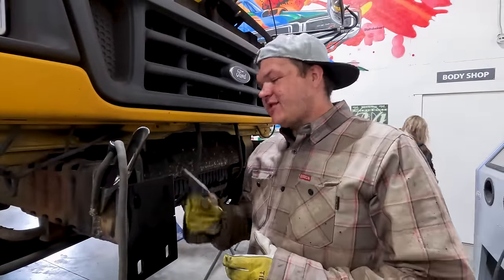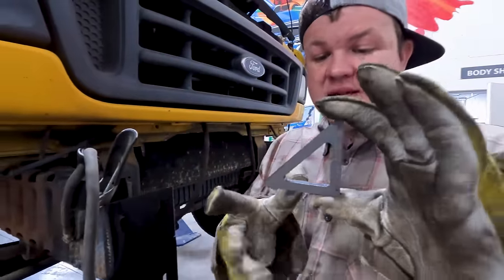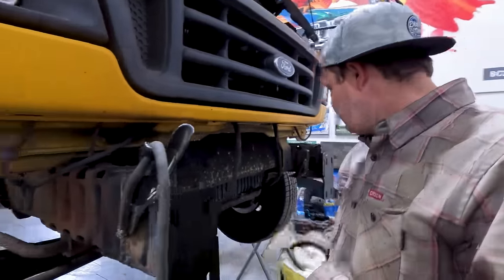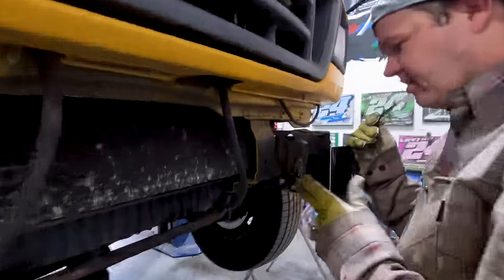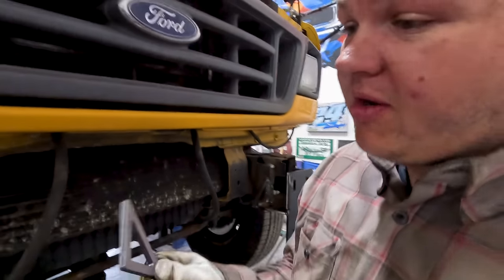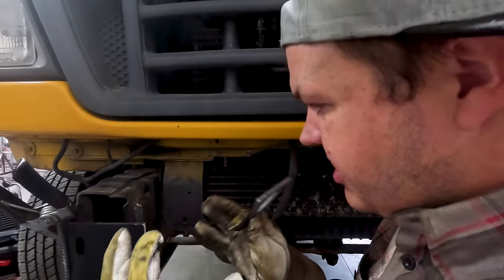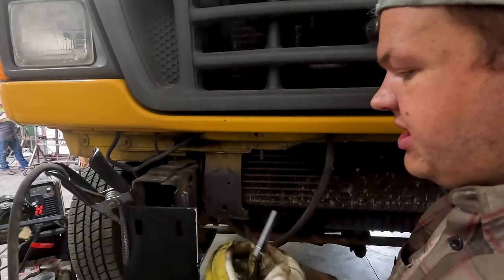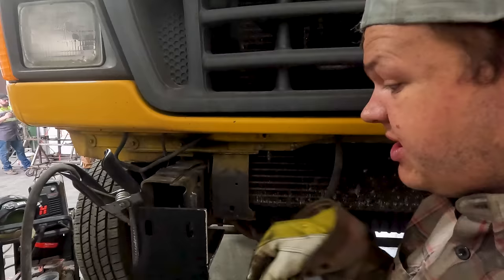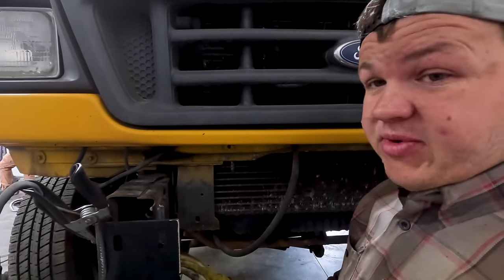I've got to put a gusset on my passenger side frame end, but Barnes makes these super awesome gusset brackets. It's just a little bit too big for what I need, but I used one of their gussets over here — it is overhanging like a half an inch, but I figured that's okay. We're going to go to the plasma table and make a new gusset for this side, because this is where our strength is needed — right where we mount the winch plate. After I cut this on the CNC plasma table, we're going to mount the winch plate and put the bumper on.